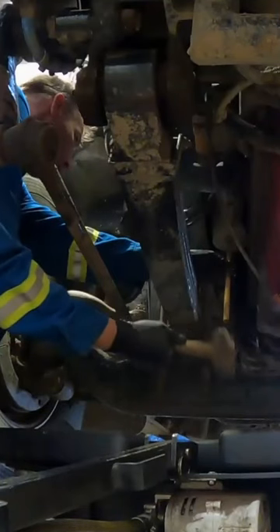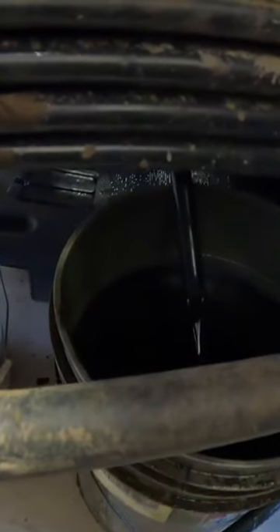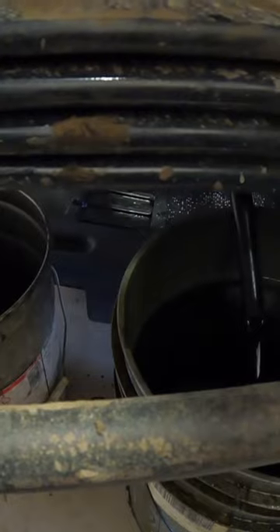I like to punch a hole in the oil filter before I take it off. Let it drain. Start draining the pan's oil. We have quick couplers; your truck may have the factory bolt. Just be careful — it's going to be hot. Don't drop it in the pail.